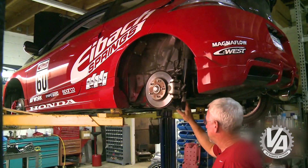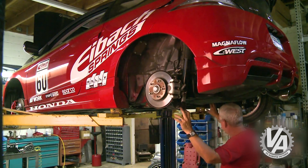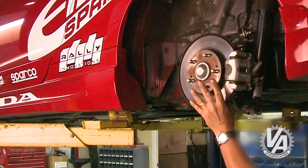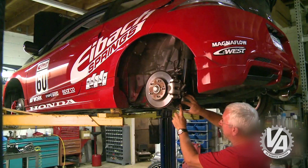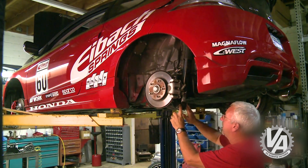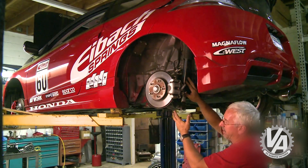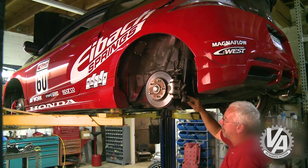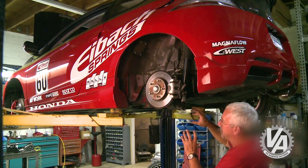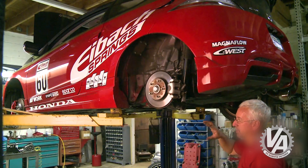The rear suspension on this is a beam suspension — it actually looks more like a swing arm. You have the pivot point up front, then a cross piece that goes back, and then two trailing links that come back to where the spindles bolt to. Notice that the shock is way at the back — that actually helps quite a bit. If you look at the early Insight and the first-gen Fit, they have their shock a little too far forward, so you get a lot of axle movement for the amount of dampening you get — it's not really that effective. I would imagine that the Civic Type R in Europe has the same setup where the damper is back behind the axle, meaning for every inch of travel there, you get a little more than an inch of travel on the shock, which works out to be much better control.